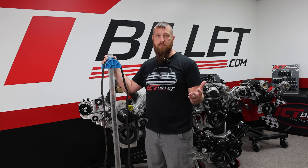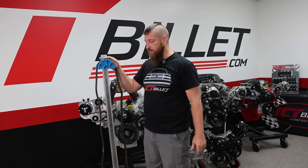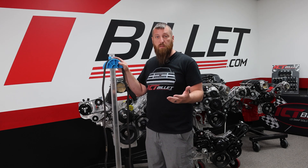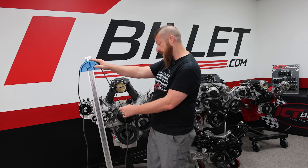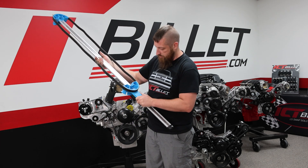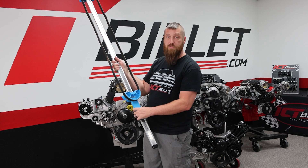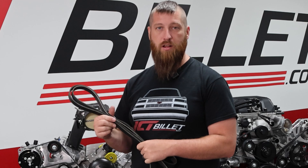So why is it just a starting point for measurements? Because not all belts are equal. When I say that — you go to the auto parts store, you get this random belt that says it's a certain length. It's probably right, but let's take this one for example. It says it should be a 93.5 inch belt, 935k6. Let's go ahead and measure it. This actually measures barely 93 inches, so it's already a half inch shorter than what it says it is. That's not going to work out. While you're measuring your belt, keep in mind not all belt lengths are created equal.